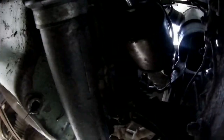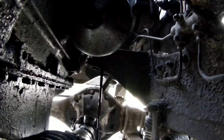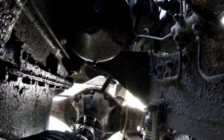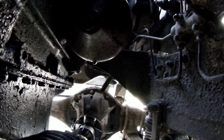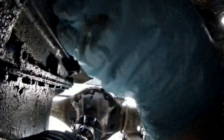Just going to climb down here to show you where the oil filter is. It's bloody awkward. I tend to loosen it off so that oil starts draining out, leave it draining for a bit — it drains right down on that front prop shaft and goes everywhere when you undo it and pull it out. Sometimes it just goes all up your arm.